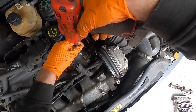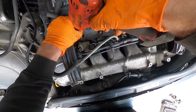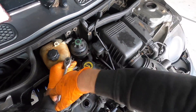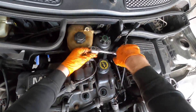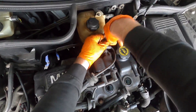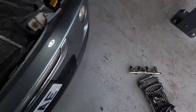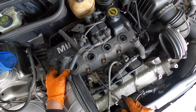We're just going to get all these little 8mm bolts off the side. I'm actually quite worried because some of these bolts look really, really rusty, so I don't know if I want to be using the impact gun. Getting the last rocker cover bolt off now — they've all been pretty good so far. I think there's 10 of them. Eight came off really nicely, this one I had to whack the same size spanner on, and this one down here I had to whack a 7 on. But they're off now — they're not really tight, just a little bit rusty. Might need to give it a bit of a pry with a screwdriver.